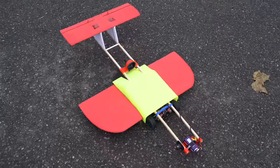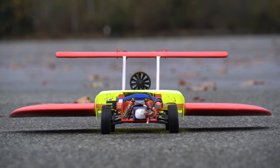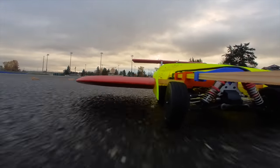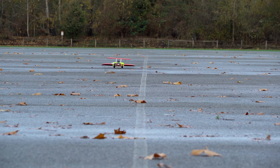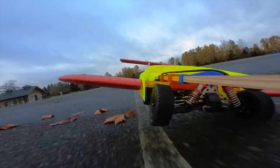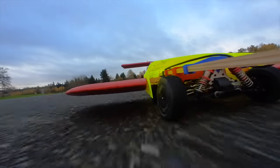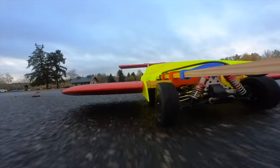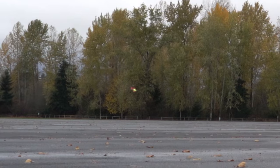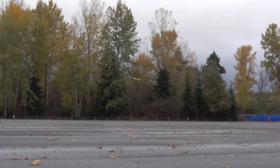Now back to the flight. For the first day I did not have a flight controller on board — it was just a normal RC receiver going straight to the servos, so no stabilization or anything like that. The first thing I noticed was that it needed a lot of airspeed before even getting close to taking off. These wings are not really all that big and the RC car's chassis is pretty heavy, so it's really not an optimal flying machine. The wing angle of incidence relative to the fuselage and the tail is 5 degrees, and in hindsight I probably should have given it a little bit more. After doing a few hops it became clear that it did not have much of a natural tendency to stay low to the ground — with enough airspeed to take off it would just keep climbing. At one point I even just let it fly like an airplane. It certainly didn't fly well, but it did fly, at least for a little while.